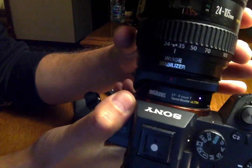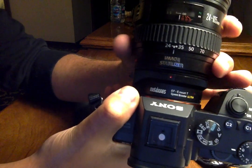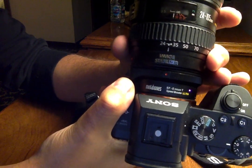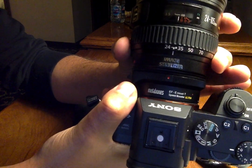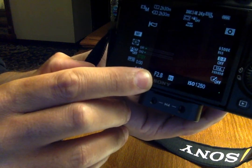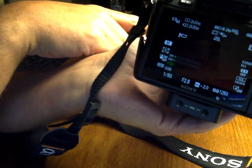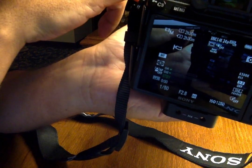What I figured is: don't screw the lens in all the way, but just a tad less. I just turn it and now I get a reading — probably because there is a misalignment between the sensors on the lens barrel and the Metabones.